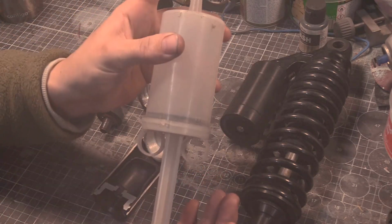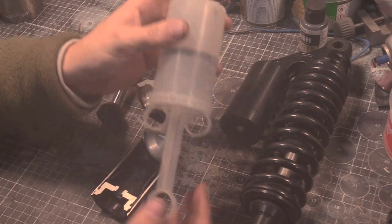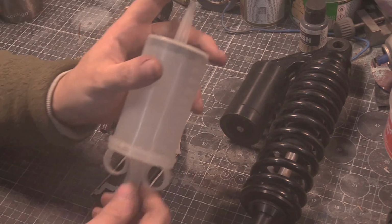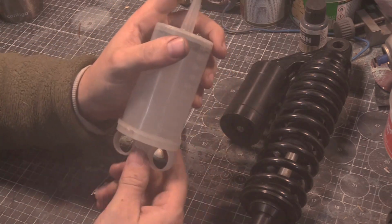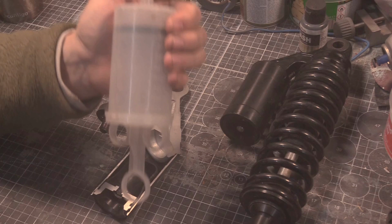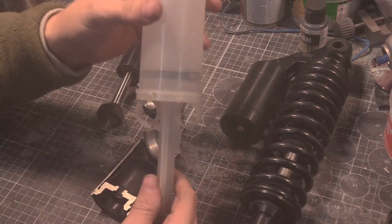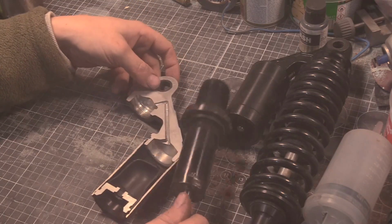Now, you can have it so you just blank it off. Some earlier systems just had a gas in them. If you just have a gas, all you're doing is relying on the compression rate of that gas. It's leaking, but imagine it was sealed. You can compress it, but as you compress, it gets harder and harder to compress. So you've got a kind of forever damping that doesn't need any adjustment. It will leak eventually, but whatever. Which is basically what this thing is: we have this piston in this cylinder.